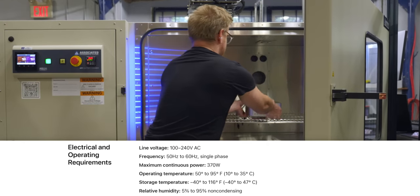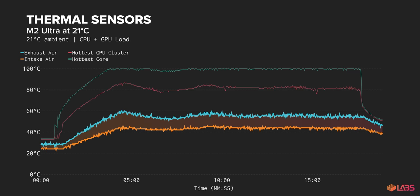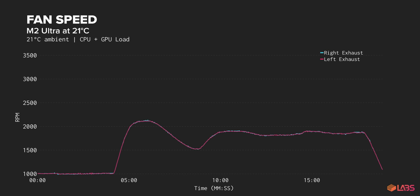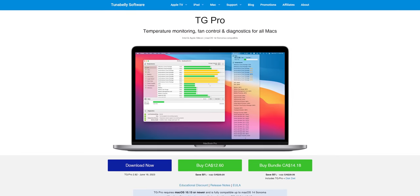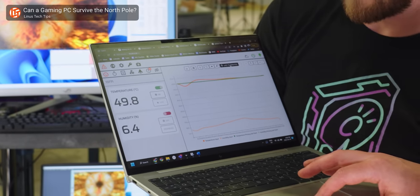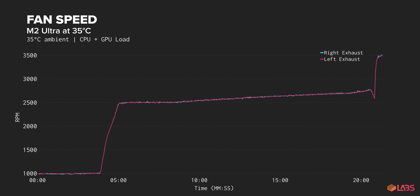Speaking of which, there is one more claim we need to verify: operating temperature. To do so, we popped the Mac Studio into our environmental chamber and let our combined CPU and GPU load rip. Fortunately, the Mac Studio's thermal design is quite capable of handling the load at room temperature. However, it's worth noting that the system does throttle its performance rather than increase the fan speed beyond 1,900 RPM. That means you could end up sacrificing some performance for lower noise unless you use a utility like TG Pro to auto-max your fans. To simulate a warmer environment, we cranked our ambient heat to 35 degrees and unfortunately it chokes pretty hard here. That's disappointing compared to the perfect performance we saw from an RTX 4090 at these temperatures. The fans do finally push past 2,000 RPM and creep a little higher over time, but even after 20 minutes they never managed to max themselves out despite the CPU obviously throttling.